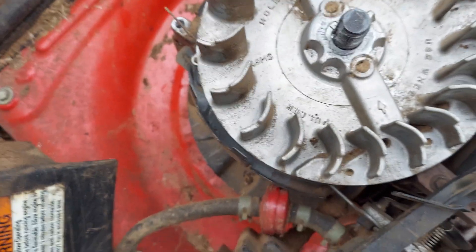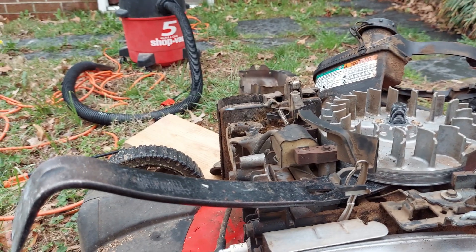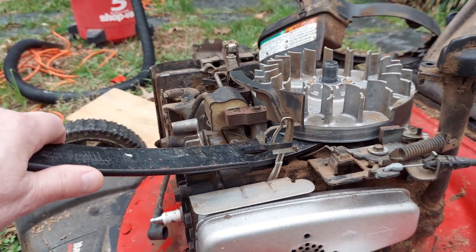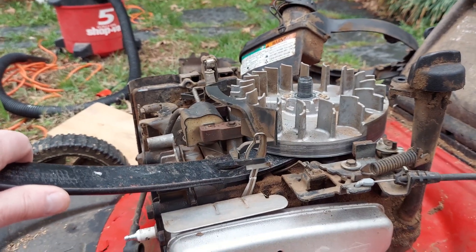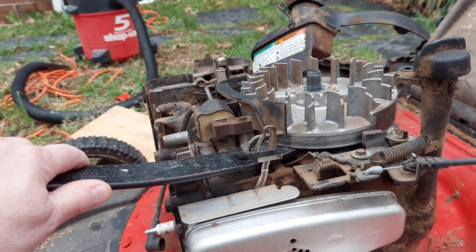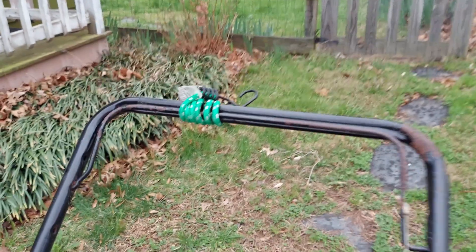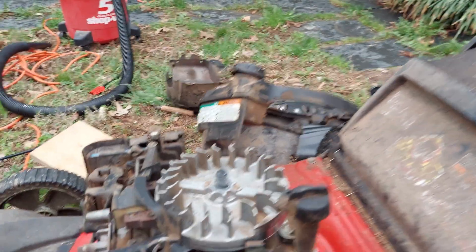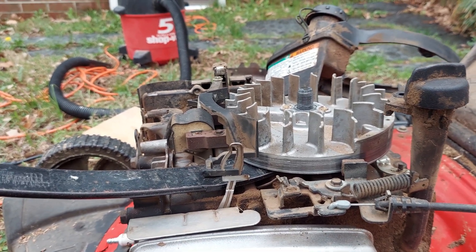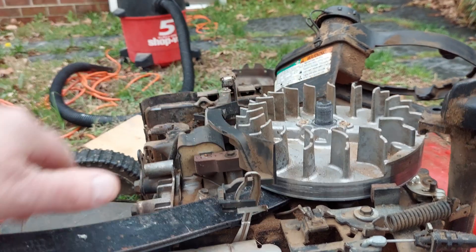This reads: use a wheel puller or flywheel puller to remove — but we don't have one of those, so we're not going to do that. Since we don't have a flywheel puller, what we're going to do is use this pry bar. Find a pretty solid spot because you're going to pry pretty hard and you don't want to bend anything. What we're going to do is pry this and hit it with the hammer at the same time so the vibrations knock the flywheel loose. Make sure you have the brake disengaged — I've got the brake bungeed together so it's disengaged, which will allow the flywheel to pop off. I'll try to describe what happens after I do it.